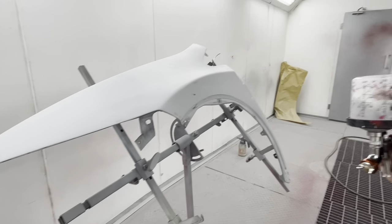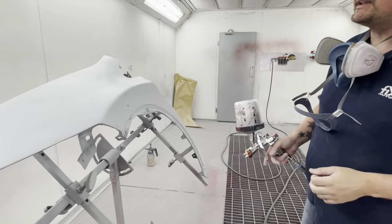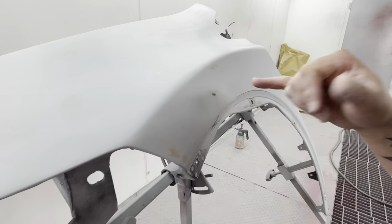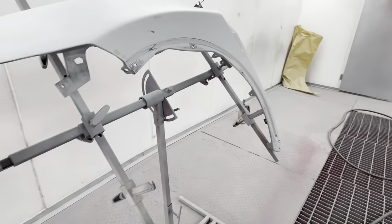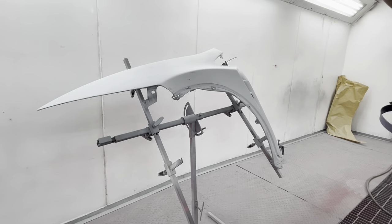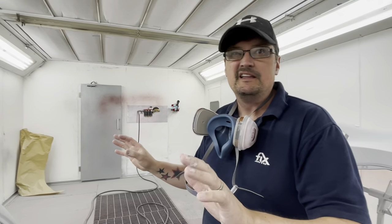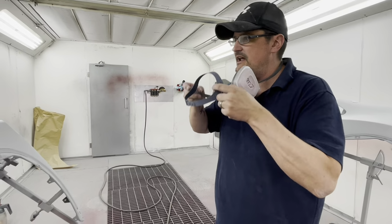The bonnet's pretty good, so you've ground that once, you've flattened the bonnet, that's good enough now to carry on with. So the bonnet's pretty good, but the wings need a bit more work. The wings have still got little holes all down there, and these little bits and holes are not good enough for us to paint really. So we'll flat them smooth now, and hopefully put two nice coats of primer on, where you'd want them to be really.